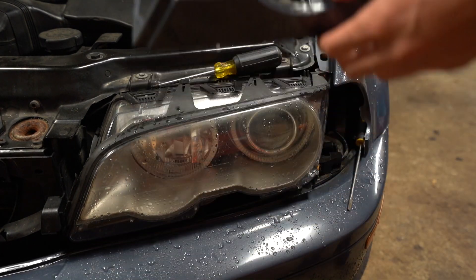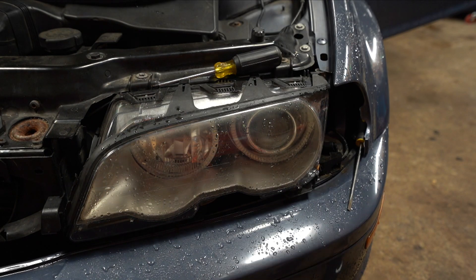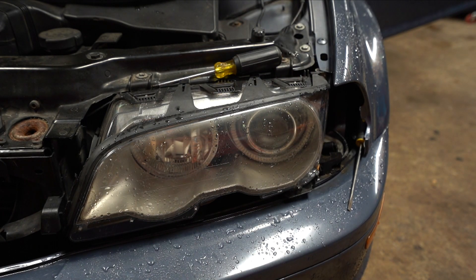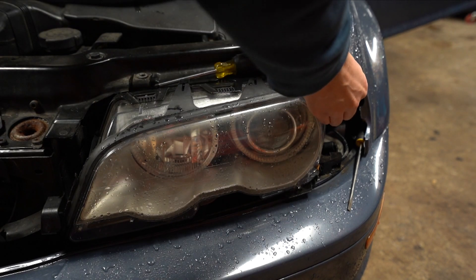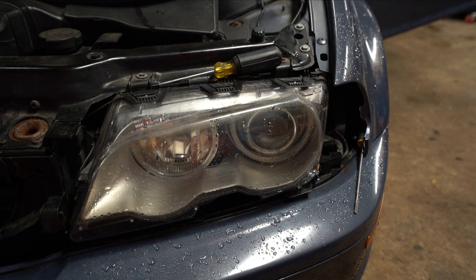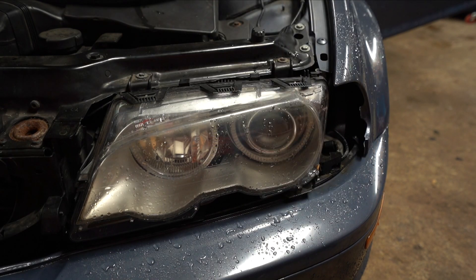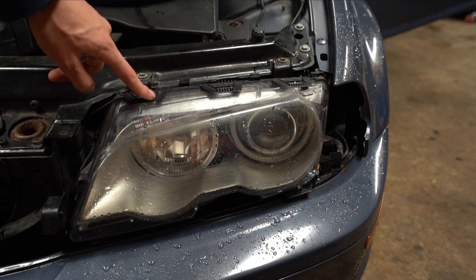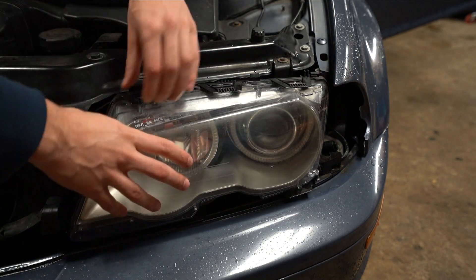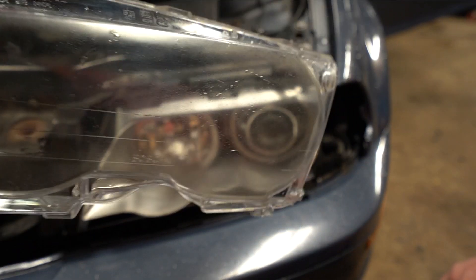It comes out just like that. It is raining outside so I'll probably wipe down my headlight. We also have to remove the top piece — there are just clips and you can pull it out. It would definitely be easier to do off the car but I don't care about mine. Now you can actually pop off the headlight — there are clips here, here, here, and all on the bottom. Try to go carefully — you do not want to break them.